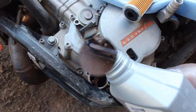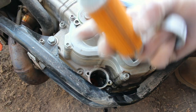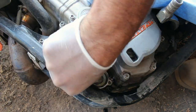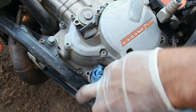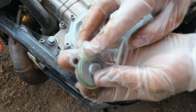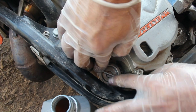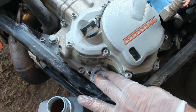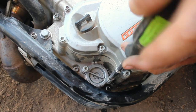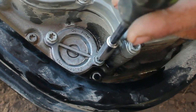Following the manual, I filled the oil filter cavity a third of the way up with engine oil and filled the new filter up with oil before popping the rubber boot side of the filter back down into the hole. I gave the oil filter cap and sealing surface one more wipe down, then wiped a dab of oil on the rubber O-ring around the oil filter cap for a good seal. I also gave that O-ring a quick visual inspection — you'll want to replace it if it has any cracks or rips. With oil in the cavity, the filter in place, and the O-ring inspected and lubed, we can pop the oil filter cap back on and secure it with the two Torx T30 star bolts.